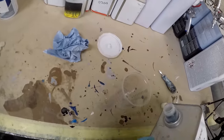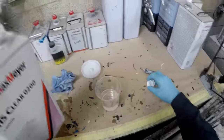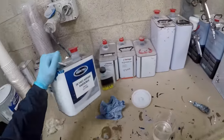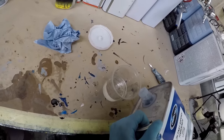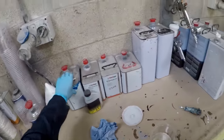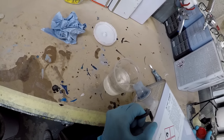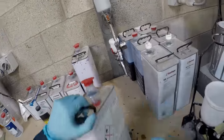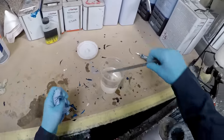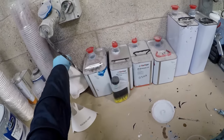Back to this job — at this shop we mainly use two clear coats: the Max Meyer 0200 which I'm mixing here, and the Max Meyer 0300. The 0300 HS we normally use for private work and higher-end, bigger-paying jobs. The 0200 we use for all the trade work and quick bumper blow-ins — although it says HS, personally it's the thickness of an MS and has the build of an MS. For these quick trade jobs it's a little bit easier and cheaper, so using two different clear coats helps keep costs down.